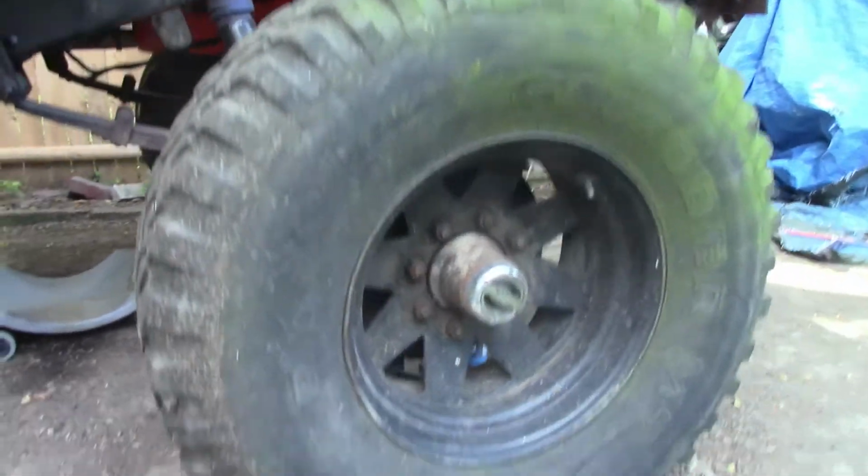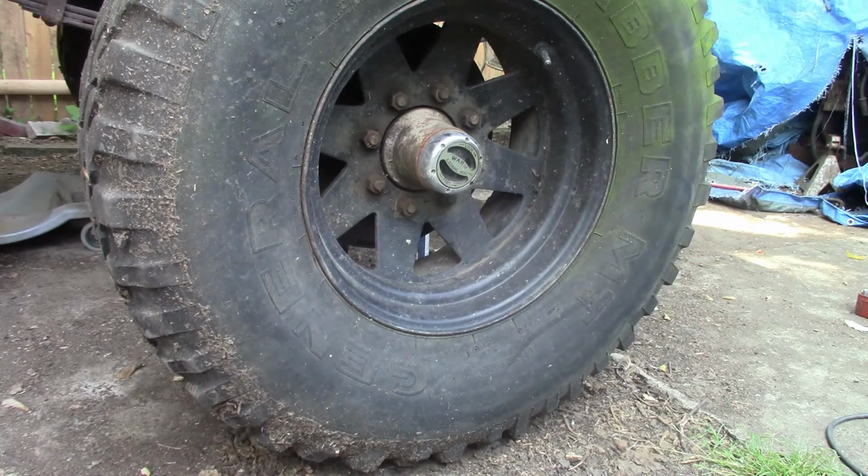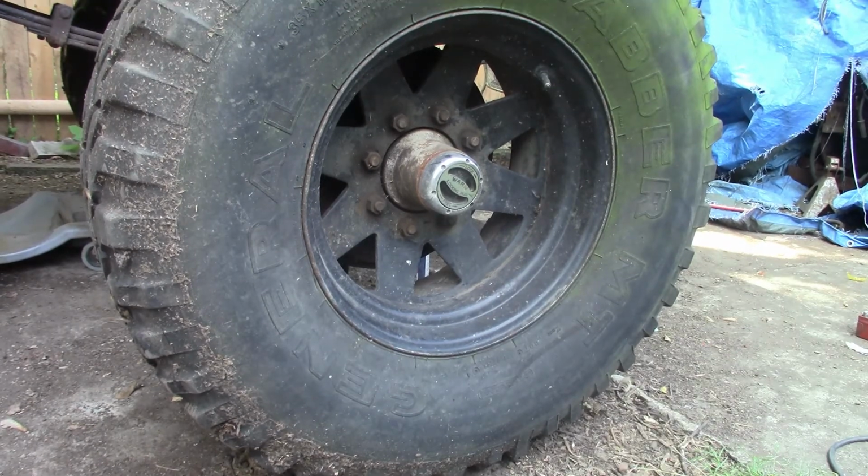So when we're out and about, we just unlock a hub to make it easier to turn, because I don't have the hydraulic assist on it, so if it's locked in, it gets to be a handful. You just unlock one hub, that way you can turn as usual, but it puts all the force on one tire, so you gotta be careful. If you get it in a pinch, you can snap an axle.